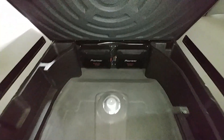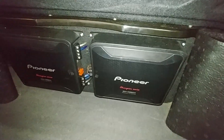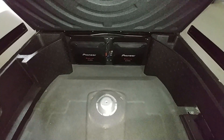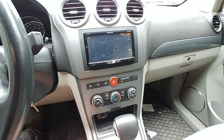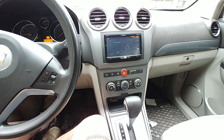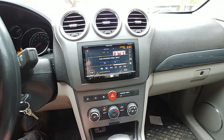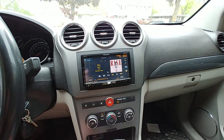This is where I hide them — where the spare tire is. There's a perfect spot right there. The problem with this is that one side has all your power, inputs and outputs, and the other side has your RCA input and gain control, which makes it very hard to get to. I need to turn it down because right now I'm pushing that 12 a little too hard — I was running the dual MTX 10s at 2 ohms. I'm using a Pioneer head unit, and I have the subwoofer control right down here. In all four doors are Infinities. Much better — before the sub was overpowering everything, now it sounds pretty good.